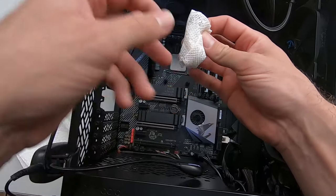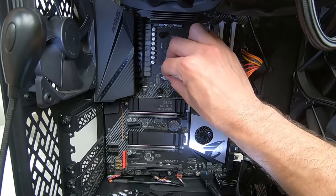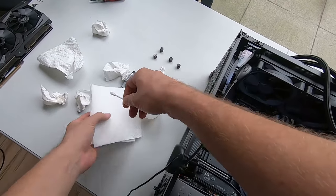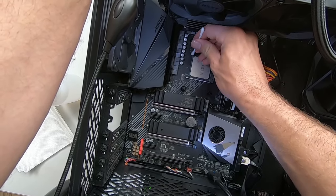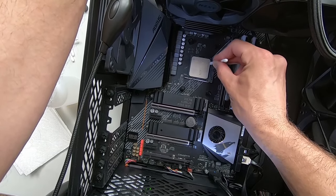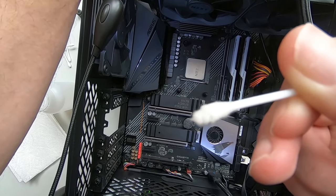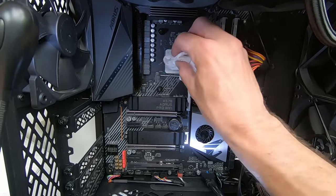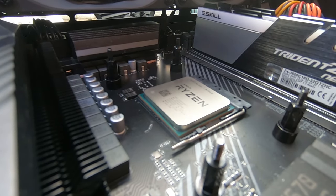Then put that aside and do the same with the CPU but with one minor added step. If you don't have cotton swabs you can do this with paper towel — that's fine. Take the cotton swab and moisten it, but don't make it soaking or dripping wet. It won't kill your computer if it drips on the components, but if this is conductive thermal paste and it seeps into places where it's not supposed to be and the alcohol evaporates, it can cause problems. Take that cotton swab and just clean the sides of the CPU. Once that's clean, go ahead and give the top of the CPU one last moist wipe. It should look super clean with no streaks or residue — ready for the new thermal paste.